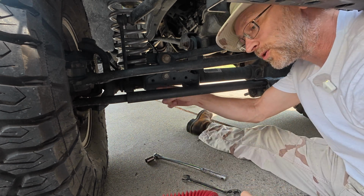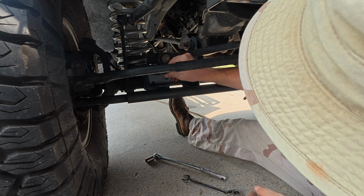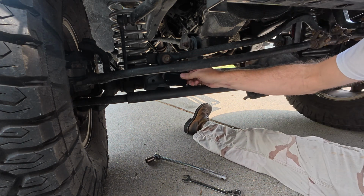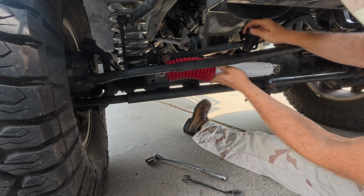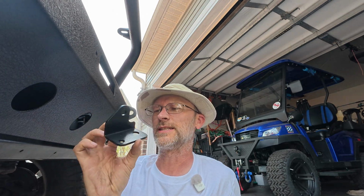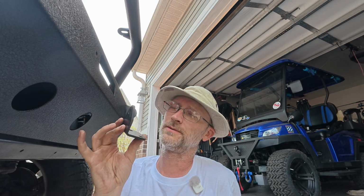This is the factory mounting hole. Now, once you flip this up like so, give it a nice little tighten up, and then slap this bracket in right here. I don't know why they didn't have this in here to begin with. It moves it up over here, which is out of the way, less likely to get damaged. And then it can slide back and forth without jamming into the bracket. It's like genius. You can see its simplicity and just think, you know what? A mechanic did this, not an engineer. It's simple, elegant, basic, and it has 3 holes.